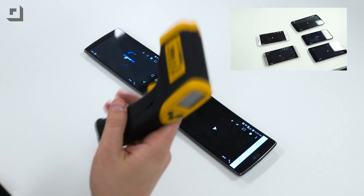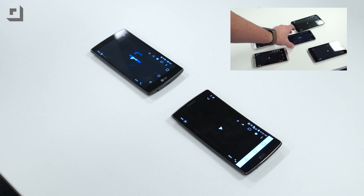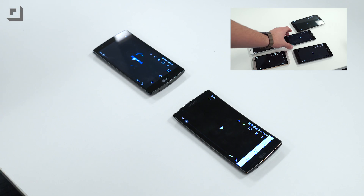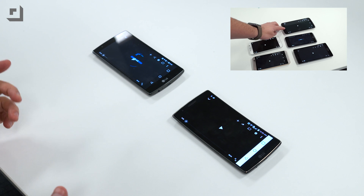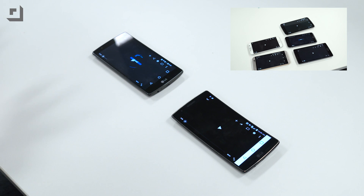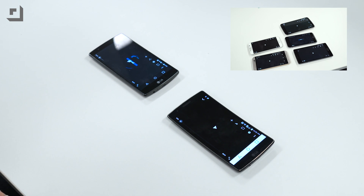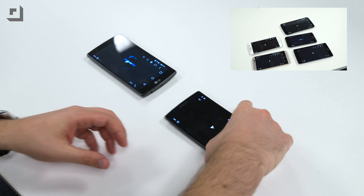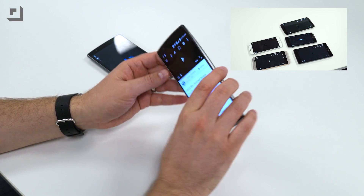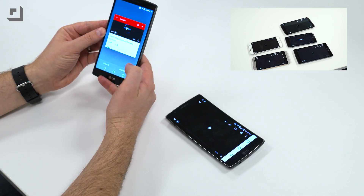To conduct this test, we have our laser thermometer. As mentioned in the intro, we're testing seven different phones with some varying processors — some the same — to see if there's a difference from phone to phone. We didn't want to pick every single flagship, just a sampling. Starting with LG's: we've got the G4 with the Snapdragon 808. Screen resolution will differ on some of these, so we'll see if that results in higher temperatures. The G4 has 2560 by 1440, and its little brother the G Flex 2 has the Snapdragon 810 and a 1920 by 1080 screen. No other apps are running — brightness all the way up, volume turned down.